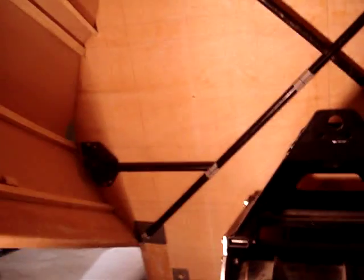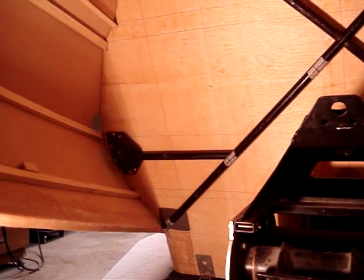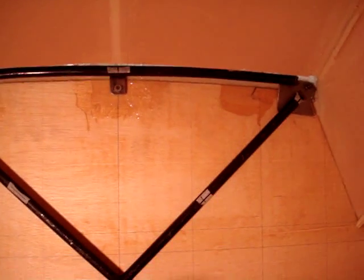It interfaces with the rear bulkhead, and the roll cage continues on in the back of the car. On the back of the rear bulkhead here you can see an X pattern of bracing, which provides extra protection in case of rollover. We also have an upper member there to protect the roof of the car.